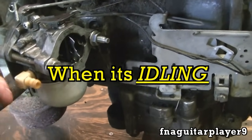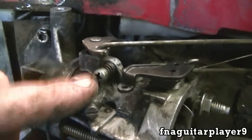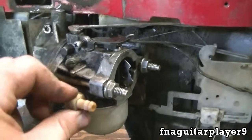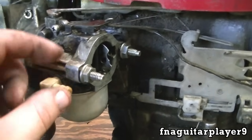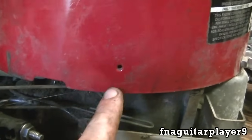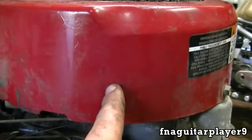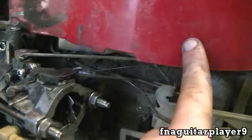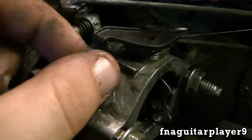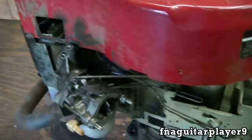So that's full throttle and choked at the same time — I don't like that. I like starting an engine when it's choked at idle, so I'm just going to hold the throttle back when I start it. This screw right here is your idle speed adjustment, and this is your main fuel-air mixture adjustment screw. These carburetors don't have the adjustment on the bottom like the older ones do. For the manual choke setup, use this hole right here for a screw. If you have a plastic cover, you might have to drill a hole, but don't use a screw so long it can hit the flywheel. Put a choke cable clamp here and hook it into this hole. If the little tip breaks off, just drill a hole up here.